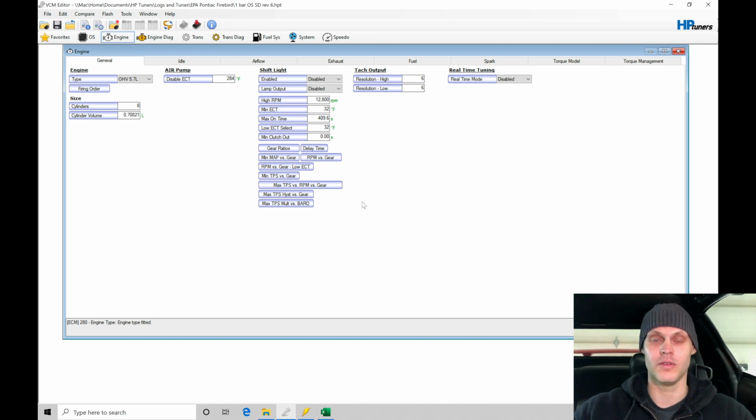So in the last few videos, I believe it was in the third video, we set up all of our base running airflow table. We used a histogram to create a channel for us. We populated some of the values into that. We're going to check it now on a colder temperature. We were at the warmer temperatures then. And then we're also going to be looking at the idle effective area table.